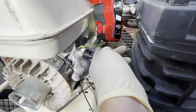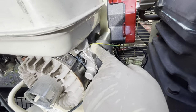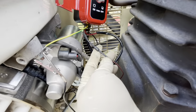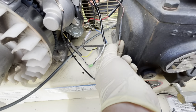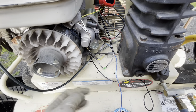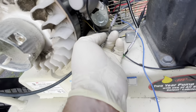So we have a bunch of wires coming out of here. The short one is a ground — I think it just went to the fuel tank there. We have a brown one that has this diode or resistor in there, and that just went to the other brown wire from the kit. That's from the inside — it mixes the spark and the juice. You just got to zip tie this back.